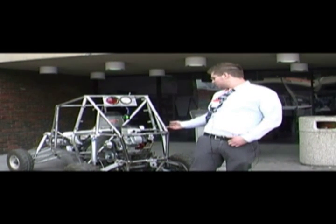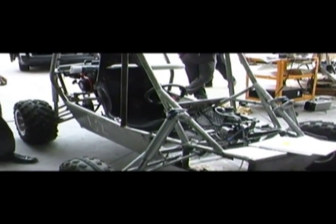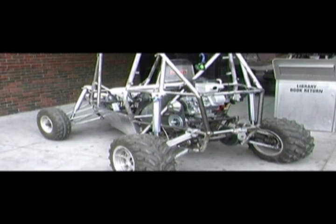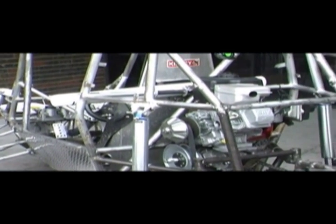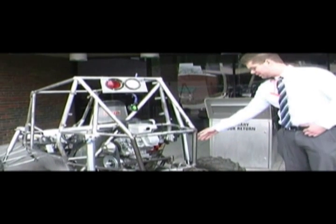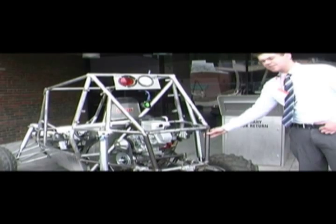This is the car over here. We're just modifying last year's car. We're going to add a flotation system, we modified the transmission, and added a new braking system. We used steel tubing to weld the frame together — it's one-eighth of an inch thick in some spots, and in other spots it's .062. There's chromoly in the front, and we went for a heavier steel in the back to make it more reinforced and stronger in case it gets hit.